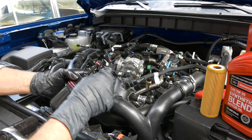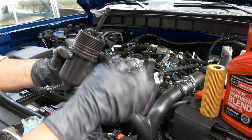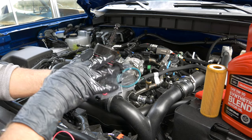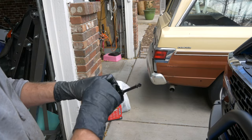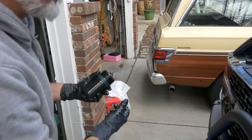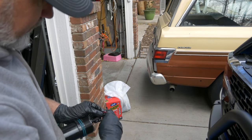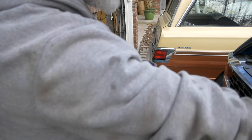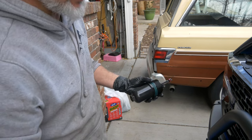You're going to see three O-rings that we're going to replace — they come in our oil filter kit. We pull the old rings off using a pick, then take the new O-rings and replace them largest first, smallest last. My suggestion: don't do this over the engine bay. The two largest ones go on with just a slight bit of pressure. The small one is tougher and requires quite a bit of pressure to get seated — use the pick to roll it on.